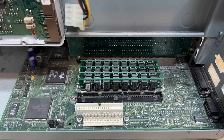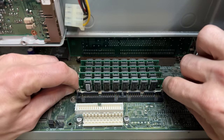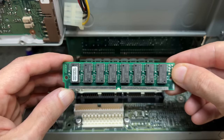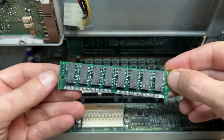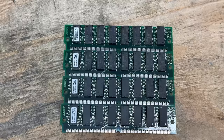We are fully populated with 72-pin SIM RAM — must be EDO. Looks like all those sticks are identical, and they're all double-sided, so they're probably 8 meg sticks. If so, that gives us a total of 32 megs of RAM in this thing. I like how it has these nice metal clips that don't tend to break as easily. That stick is made by PNY — no obvious indication of size or speed, as was the style of the time. All four are a matched set — that is a beautiful thing.